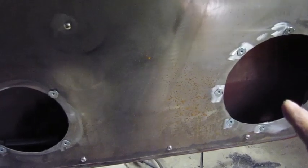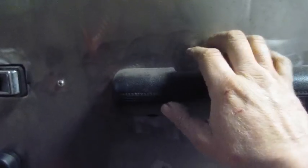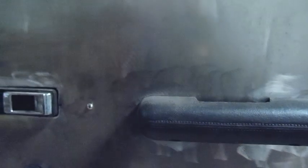I need to get the speakers on. Then I can shape the aluminum panel that I want in here — you're constantly grabbing for this door handle, so I want a piece of something that can be polished or replaced instead of paint around these areas. So we're going to put an aluminum insert in here, and once we figure out where it is, it's going to be shaped to this piece off the dash. It gets mounted with these inserts. After that, I'll figure out the bead roll — it'll probably stop in here somewhere, kind of mimicking how the '55 Chevy door was. Just a C shape. We'll put a bead roll in there, painted with an aluminum insert, and all the door speakers. I think it'll be cool enough.